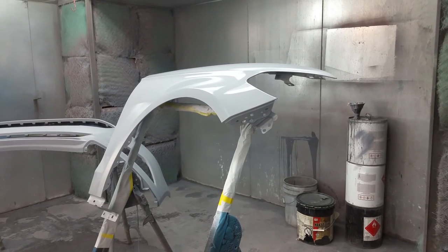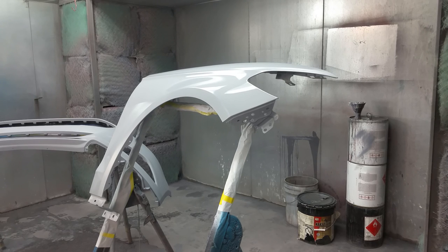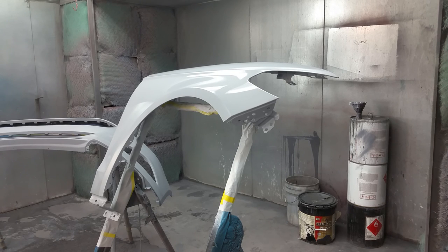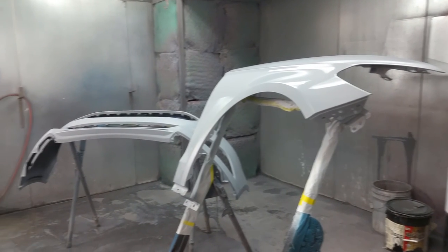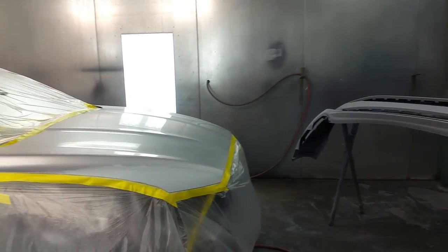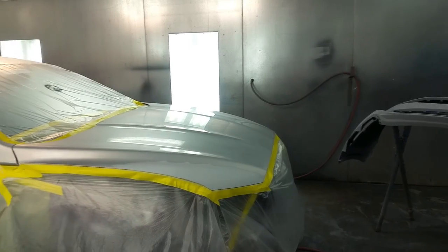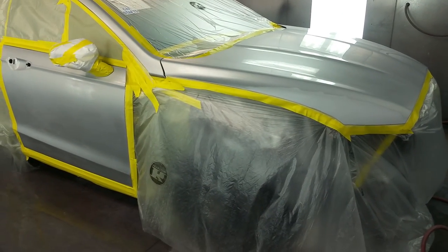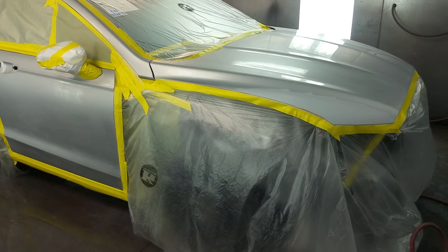See, I'm going to bring my camera a lot closer. It really gave me good coverage, okay? So now I don't need as much base. For this job, I'll be okay with one sprayable quart, which is really half a quart. It's a 1-to-1 mix ratio. So I'll be able to do the hood, which has been sealed previously, and blend in the door. We don't need to seal that, it's OEM finish, which we're blending.